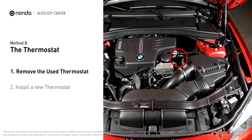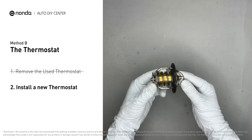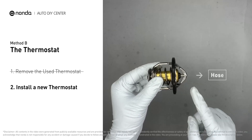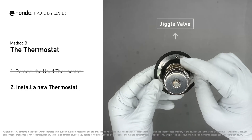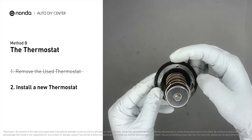In most cars, the thermostat is placed near the water pump on the cylinder head. First, carefully remove the thermostat from the engine — the engine must be cooled before attempting this. Then install a new thermostat, making sure the short end goes toward the hose and the deep end goes toward the engine. When installing it back, make sure the jiggle valve is pointed straight up to the top of the engine so air can get through the system.